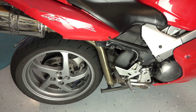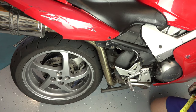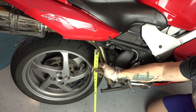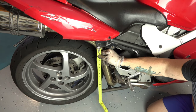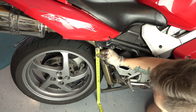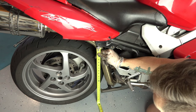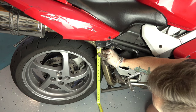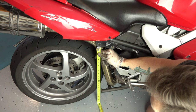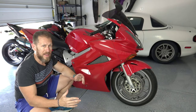We just finished lowering the rear. Let's get the tape measure and see where I am. I started at about two feet and a quarter inch. Now instead of being at two feet and a quarter, I'm at about two feet or less — like 23 and seven-eighths inches. So now that the rear is done, this is not finished yet — we still have one more step to complete the lowering.